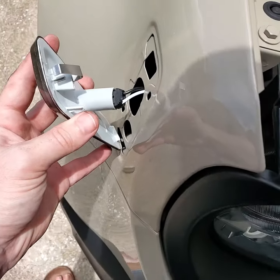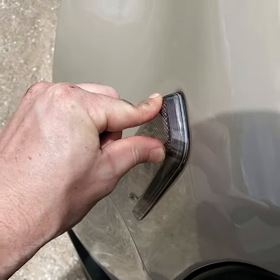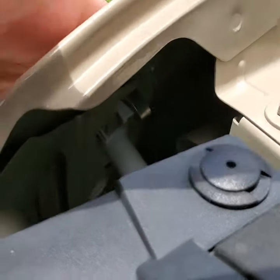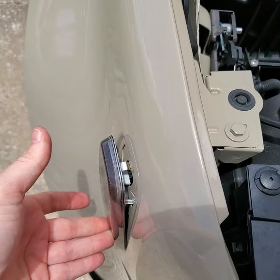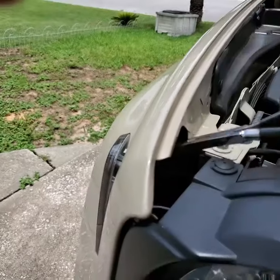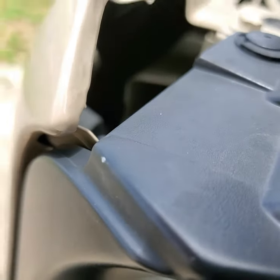I chose this side because it has a bit of an issue — something I see a lot — where you push it in and it doesn't stay no matter how hard you push it; it just pops out. Here's the fix for that: you have to come back inside with your needle nose pliers and pull on the clip. We'll grab the pliers, grab the clip, pull that clip in, and you'll hear it pop — and now it stays in.